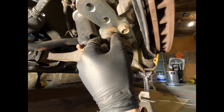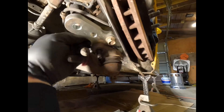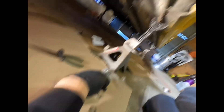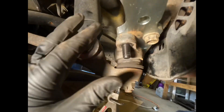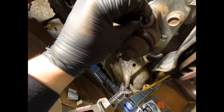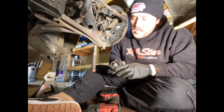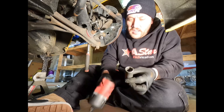The next thing is to put the lower ball joint into the plate. There are only two holes it can go in. If the plate is facing the correct way, you're going to use the hardware supplied by Chris — a nylock nut and what looks like an M8 or M10 machine bolt. Put the bolt through the top side. It doesn't come with washers, but I'm adding a couple extra for more surface area.